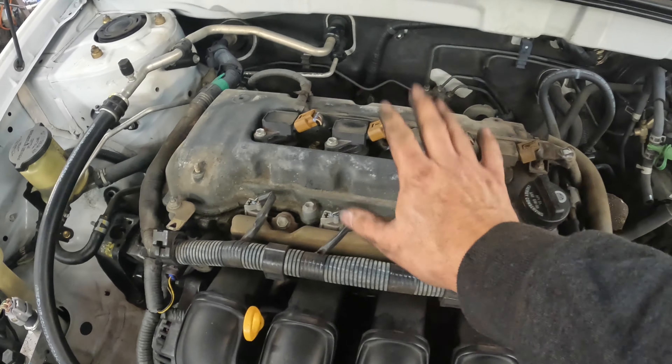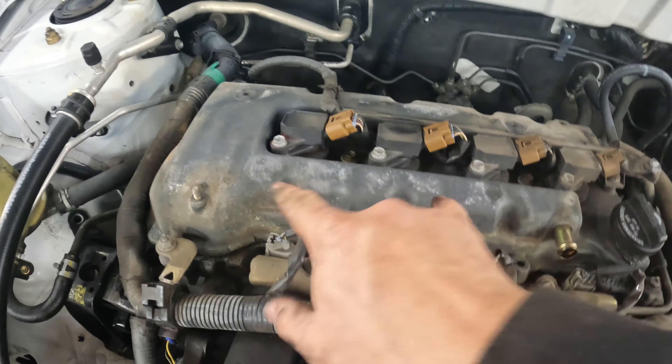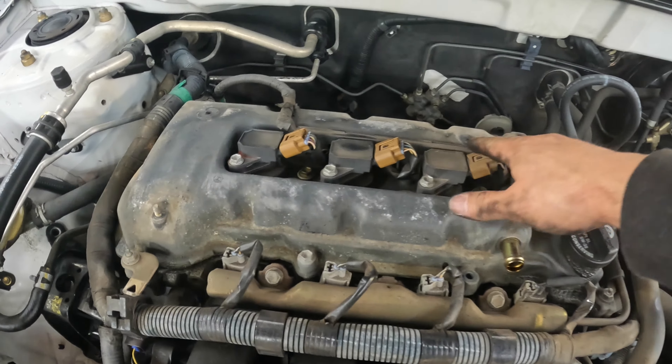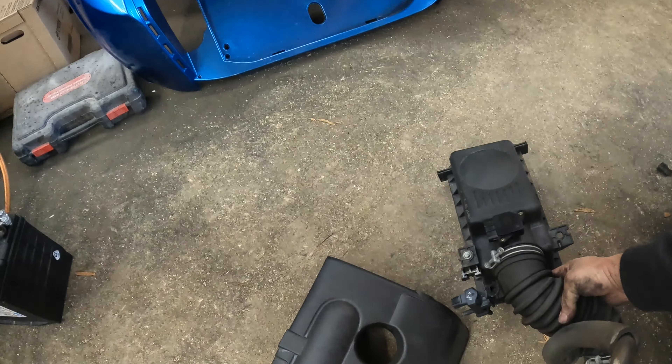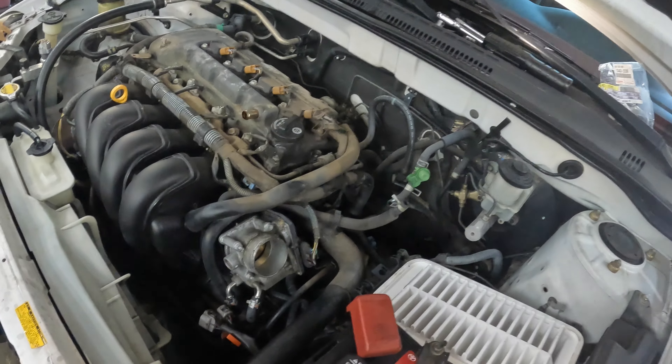As you can see, we took the cover off. This one only had two bolts holding it on — two in the front. They should have had four; most of the time they have two in the back and two in the front. We took the hose off here and then just these two — the hose clamp — and it came right off. That's two little hoses, the big hose, and the clamp. The speed sensor is next.